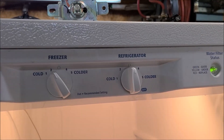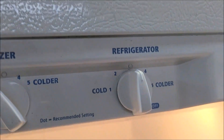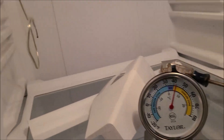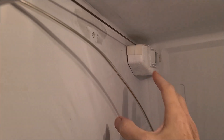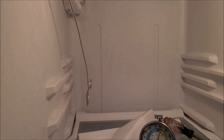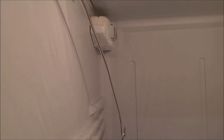It's been about eight hours this time. I've overshot a little bit — I set it in the middle and I'm just a tick over 40 degrees, so I know I'm getting close. I'm going to go ahead and put my thermostat wires and all this up where it's supposed to be, then dial the screw back just a little bit more to try to get it around the 35-degree mark.